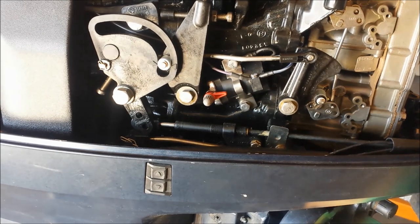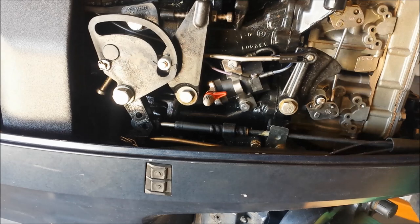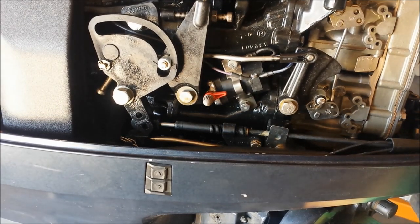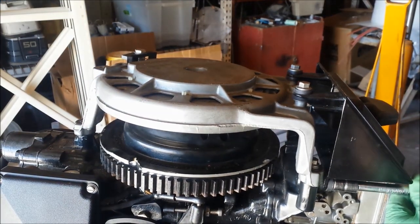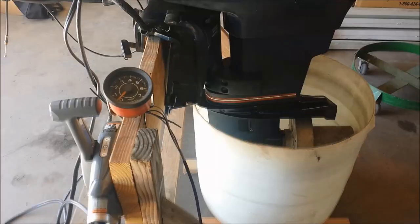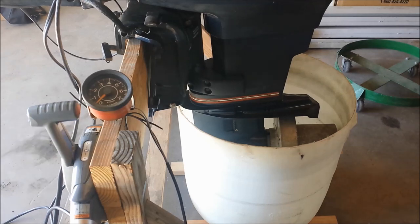You can't get the proper test propeller right now for this outboard, and that is a serious problem. But you could go out and hook up a timing light while you're going down the river at full throttle and check the timing that way. Realistically that's just a problem waiting to happen, but I will do that — hashtag YOLO. So we'll rig up a test propeller and test it out. First thing is to pull off the manual starter so it's not in my way of seeing the timing marks, then get this thing into a bucket of water, hook up some electronics, and we'll do a little test run.